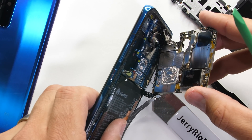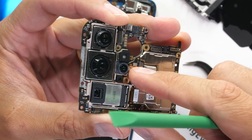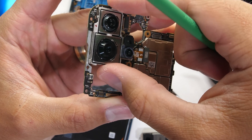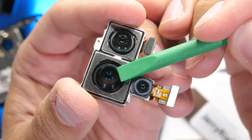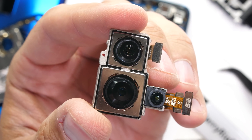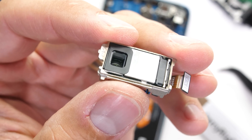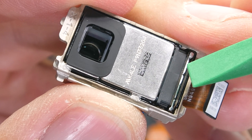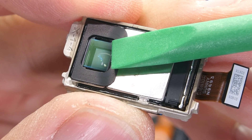After peeling up the black stickers holding down the front facing camera connections, I can gently lift the whole motherboard out of the frame. It's a dual stacked motherboard like we've seen inside of the iPhones and recent Samsung phones, so that's flagship material. It's also got multiple massive cameras. The top 40 megapixel ultra wide camera does not have OIS. The large 50 megapixel regular camera in the center does have OIS. The 12 megapixel periscope telephoto camera does have optical image stabilizing, but there are no physical moving parts visible from the exterior — similar to the S20 Ultra.